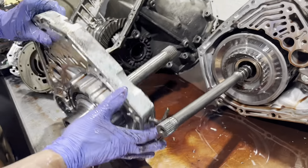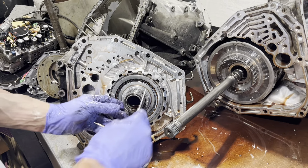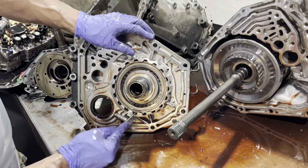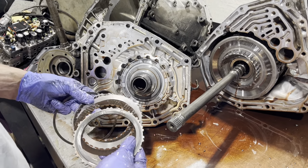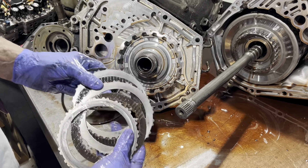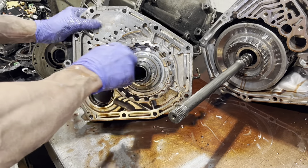This piece we're going to call the pump — this half of the pump — then you have the body and gears. You have a Torrington bearing here and a set of clutches here. This is one of the sets of clutches we rebuild and modify when we build these things. These are a little burnt, but we were able to go from two clutches to three clutches in here, which increases the torque capacity a lot. In here we have another cage bearing.